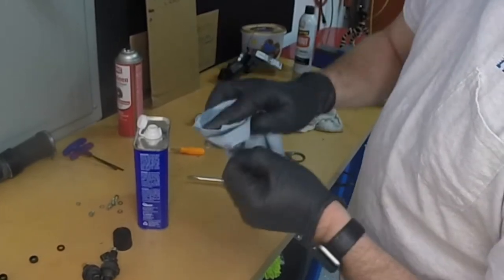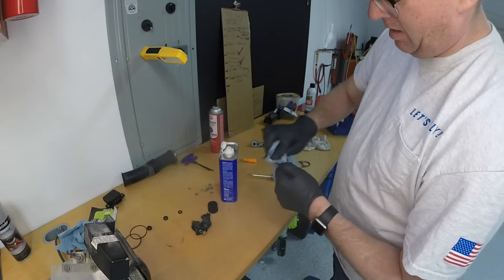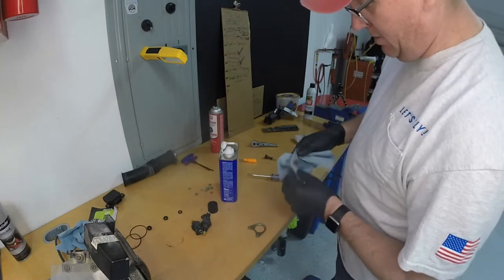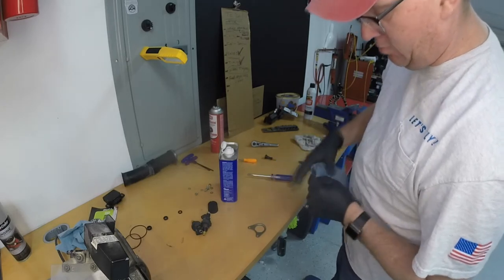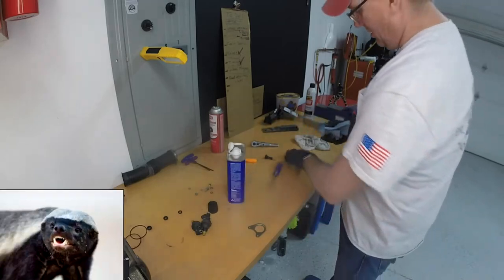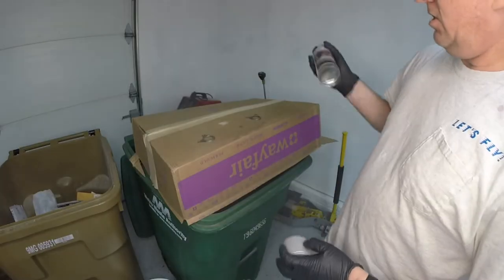And then we're gonna put a little bit of paint on there to prevent that rusting from happening again. I think the reason why that happened was when I was rebuilding this thing last time, I just wiped them off and forgot to put some clear coat or spray paint on them. So that's what happens, rust. A little bit of Dupli-Color paint for the engine, nice silver color.